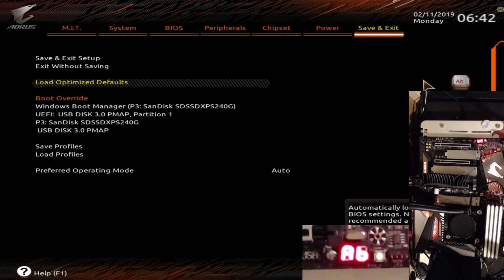The reasoning behind that electrically is basically there's a termination problem with the unpopulated DIMMs in a T-topology setup. If the DIMMs aren't populated, they add a whole bunch of extra signal and basically ruin your signal integrity. So if you have a Master and you're aiming for really high memory frequencies, you're probably going to want to run a 4x8 or a 4x16 setup. If you had a daisy chain motherboard, then you'd obviously want to run a 2x8 or a 2x16. All the Gigabyte boards are T-topology, so for all of them you're going to want to run a 4x8 or a 4x16, at least if you're going for memory frequency. That's why we're on 32 gigs here. If you're on 2x8, the main difference is that it's just going to clock lower because of the signal integrity issues.